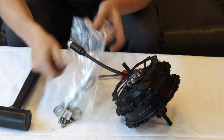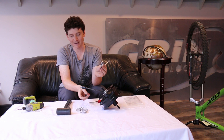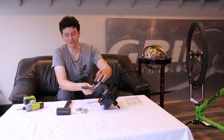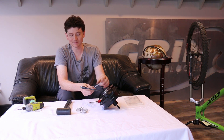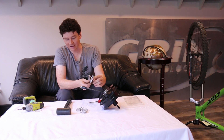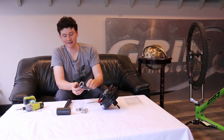The GMAC motor comes with a bag of hardware, and the torque arm itself also has a spline pattern. In our initial development we relied just on bolts to link it to the inner plate, but found that those bolt heads had a chance to wiggle loose, so we updated the design to lock it in place properly with this secondary spline.